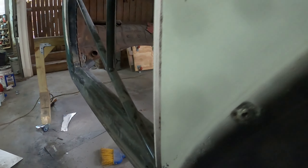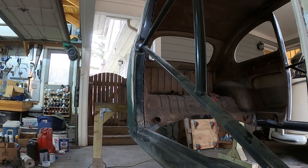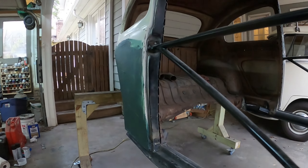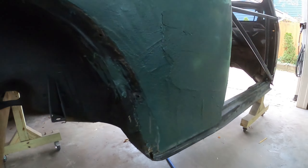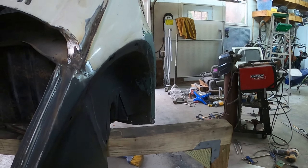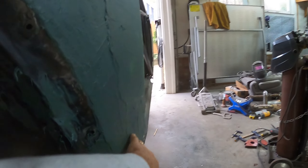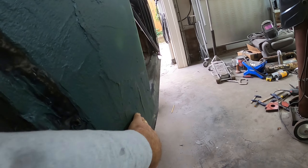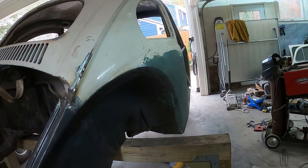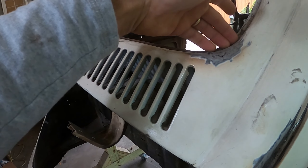You can see how it indents just a little bit in that back lower part. I'll buy as much fiberglass bondo as I need and pull that out to make sure it's shaped approximately right. You can see it's indented here, comes out on the back, then it's indented there — so I've got to build that up. It would have been better if my metal fix was shaped better, but the fiberglass bondo will go into here because there are some holes needing structural support.